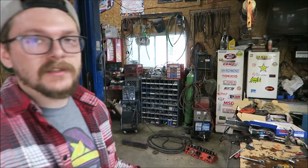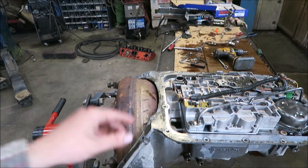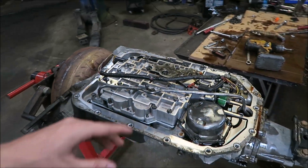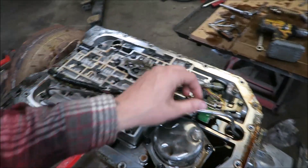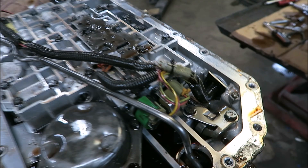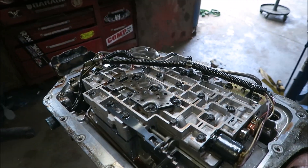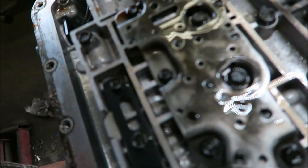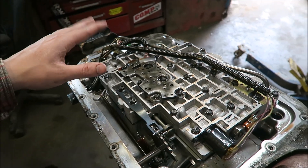That is the complete HD2 kit install - well, not complete because I didn't drill out the pump. It's not 100% necessary, otherwise they wouldn't even suggest doing it in-vehicle where you can't pull the pump out. Most people are going to do it just like this. I may throw my other pump in because I already have that one drilled out. The only thing I didn't show is just bolting it down and putting the wiring in place. I need a new harness anyway because most of the plugs broke as soon as I looked at them. I'll probably pick up a new wiring harness - I don't think they're too expensive, like $40 maybe.